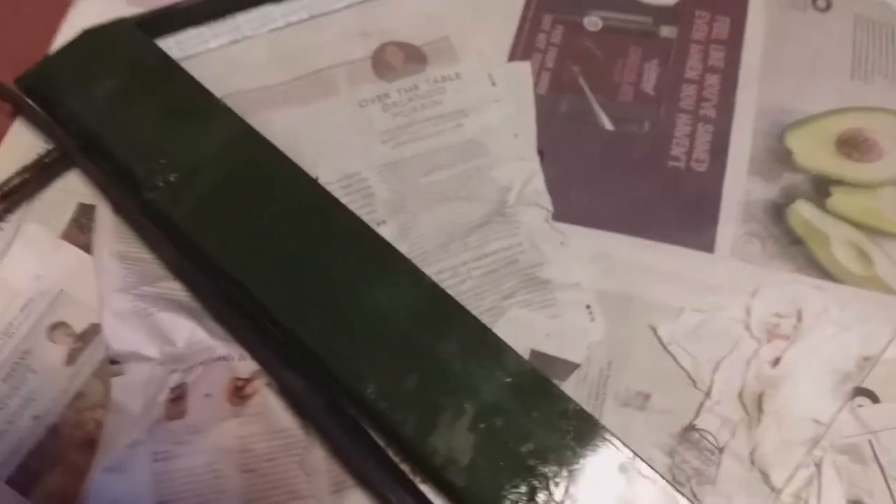This one is a Series 3 channel because it was cheaper than buying the Series 2 one, which I couldn't find, but it doesn't come with any holes so fresh holes have to be drilled. If I said this wasn't tricky I'd be lying, because this is where it gets a bit tricky. I've laid the glass in on a temporary basis — the glass is laid in and the flexi strip still has the backing strip on there, as does the bolt-on panel automotive sealant on the protective backing down there.